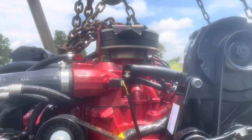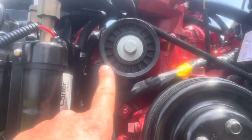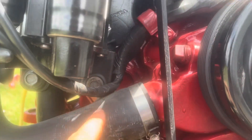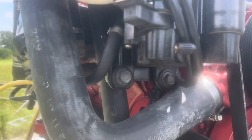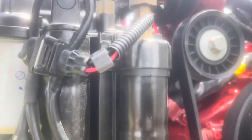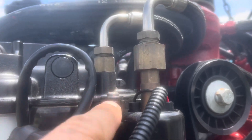Going around some more. You've got a tensioner pulley here with one bolt back in there. There's a harness bracket on the water pump wires. It's got a dual fuel pump system — you've got a high pressure pump here, a low pressure pump there, your fuel water separator here, and then there's another canister, a high pressure canister over here. That's your high pressure out right there. This is your pressure return back from your fuel rail into your canister or reservoir. The reservoir looks like it references this vacuum hose, which references the engine intake vacuum.